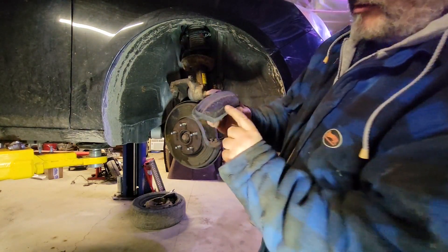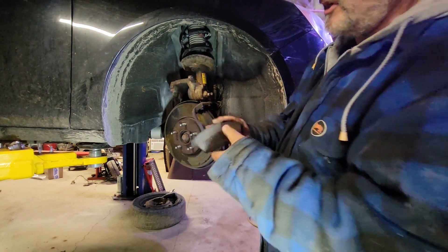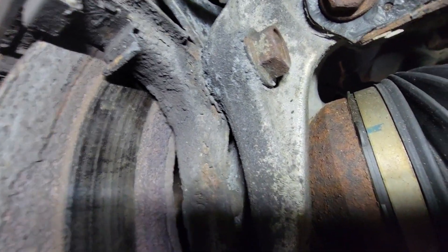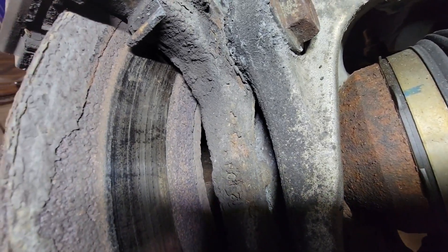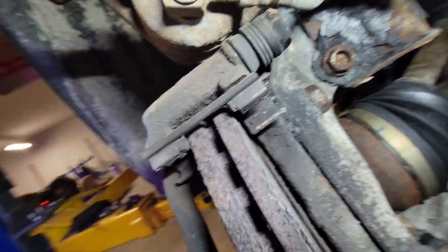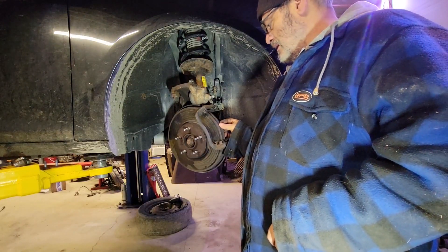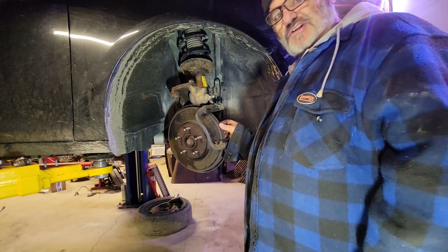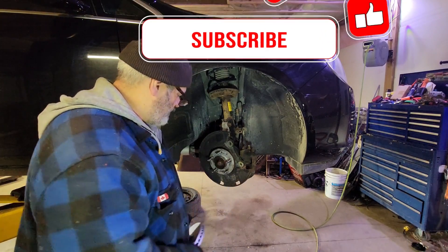The inner pad is not the problem because the pad itself is moving along just fine. You can see a really big deep groove on the inside and some pretty sharp ones on the outside. You can see the inside of the rotor — the outside part is not doing anything and neither is the inside, so maybe 20% of that inside rotor is actually working. You probably have a pretty soft pedal, and one thing you don't have to worry about is overheating your brakes because there ain't enough friction there to do that.